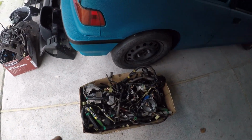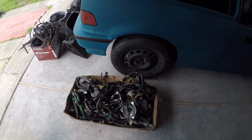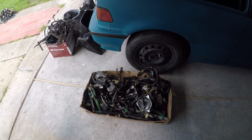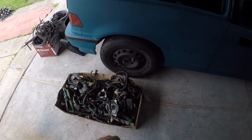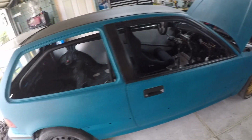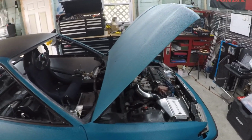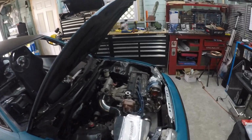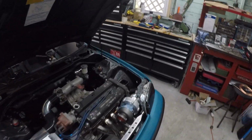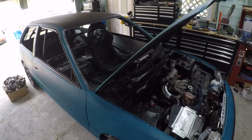This is something I just picked up yesterday. Brian doesn't even know about this yet. Kind of something that's gonna be one step back but three steps forward. This is a full chassis and engine harness from a '92 Acura Integra, the DA. So it's already OBD1. I think I'm going to pull the harness from the car that I tucked already and tuck this one, run this one in here so that it's completely OBD1 and multi-point fuel injection ready to go, so I don't have to use any jumpers. I don't have to rewire it, because this is a dual point body harness, and you know all the stuff you got to do to get the wiring right, and I wanted to eliminate any bugs, any issues. So that's where I'm at with that.